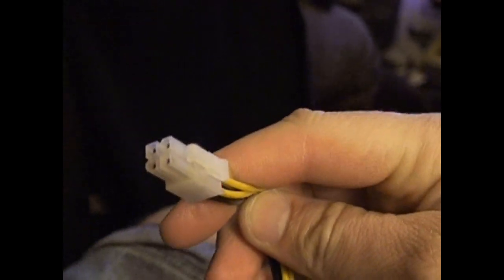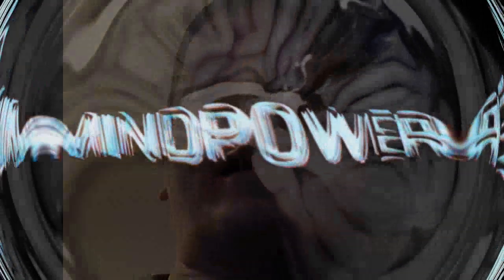We've got to plug all our stuff back in here, and we're going to find out if our computer works. Now we've got our computer all back together — it's the moment of truth. I have troubleshot my computer and actually got it working, as you can see. The issue was that I forgot to connect the little four-prong connector — it has a special spot on the motherboard. I forgot to connect it up, so the computer would not power up. But now it is powering up, and I'm not running an underpowered power supply for this computer anymore.